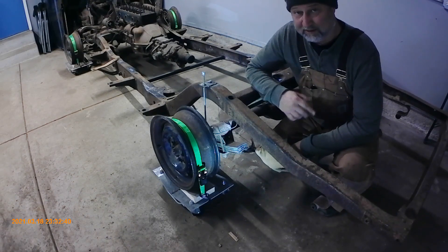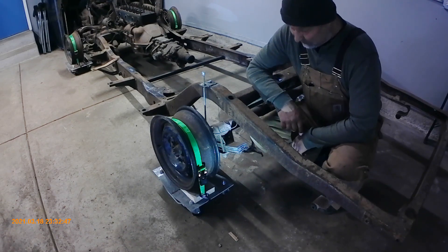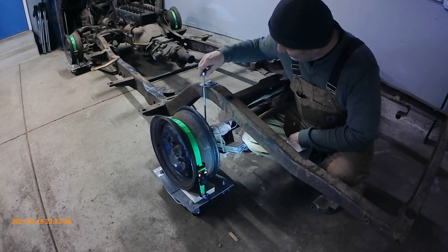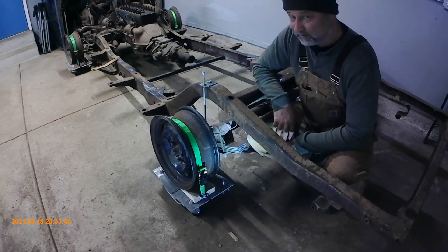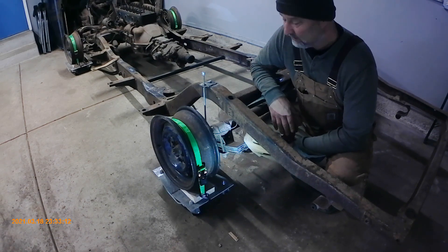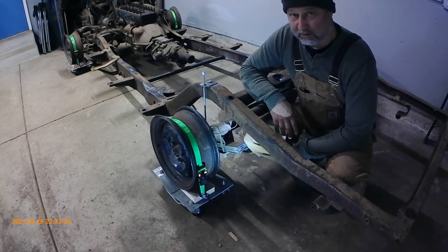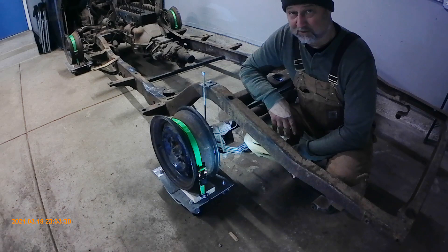I turned the camera off because I needed the extension cord to run the grinder to cut the leaf springs off, and forgot to turn it back on. I changed my mind — instead of welding a piece of angle iron from the rear end to the frame, I just took some simple threaded rod and welded it up to the frame so it's adjustable. I spent some time this morning getting the frame all dialed in, so now it's at ride height. I can tweak each corner with the threaded rod as needed. Right now it's set so the bottom of the oil pan is six inches off the ground, and when we make the new frame that's what we use as a gauge. For now, this is perfect for mock-up.